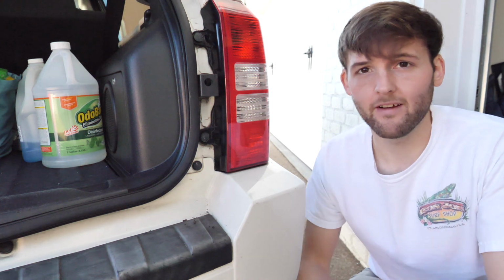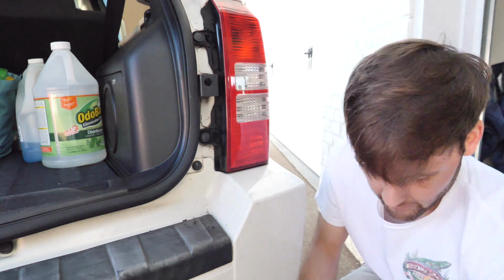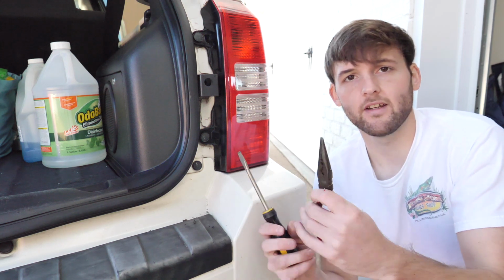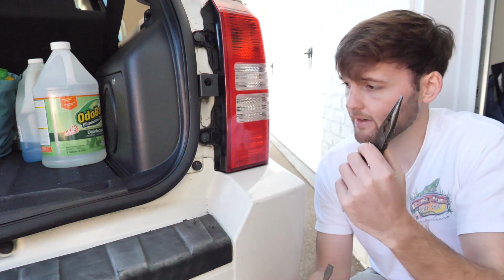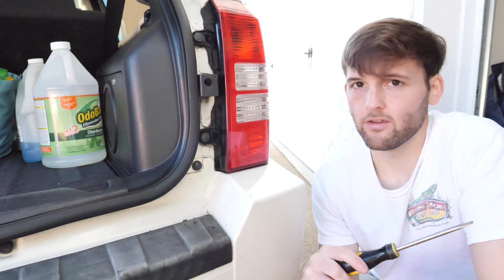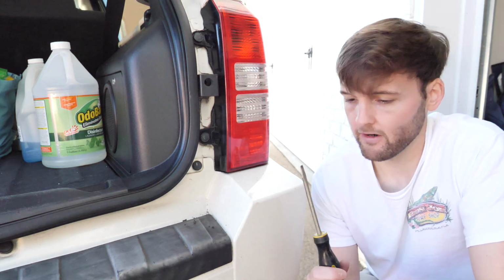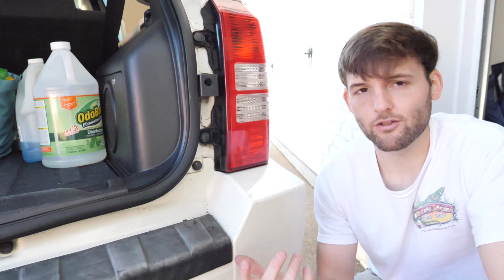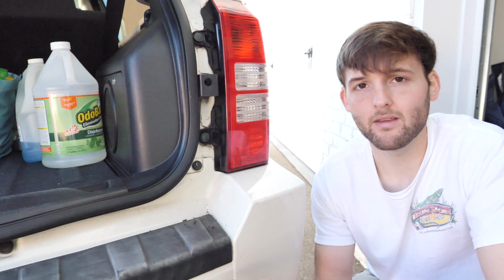Okay, so more than likely you're not going to have a pry tool. That's why I made this video, just to kind of show that trick. But I mean really you just kind of get in there and pry it just enough to get your needle nose in, and then you're pretty much able to pull the rest of it out. That's the easiest way to do it. If you try just pulling it out with a screwdriver, you'll be prying forever. Obviously it'd help if you had the pry tool, but that's why I made it. Just wanted to show a little trick on how you can get pop pins out.